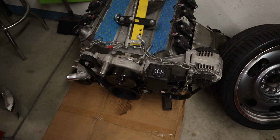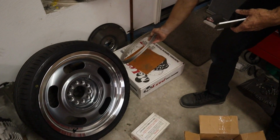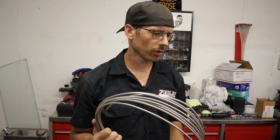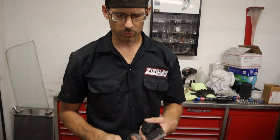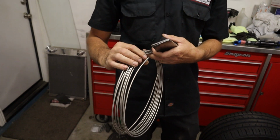We just gotta do a little bit of trimming in certain areas. So we're gonna order the woodless tray for an F-body, so we gotta wait for that. You know, we gotta order that. We have stainless hardline. I was gonna run the brake lines, but then I found out that we don't have the fittings for the brake lines because you don't do a double flare on the stainless. You gotta do a 37 degree, like an AN flare, use AN fittings.